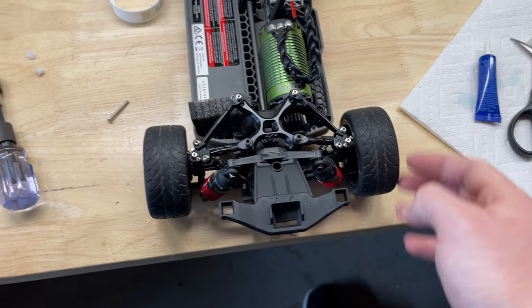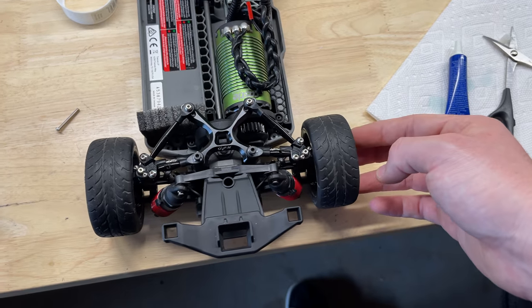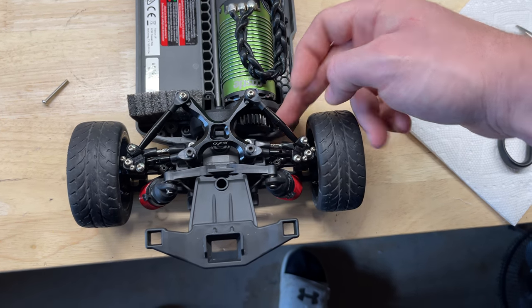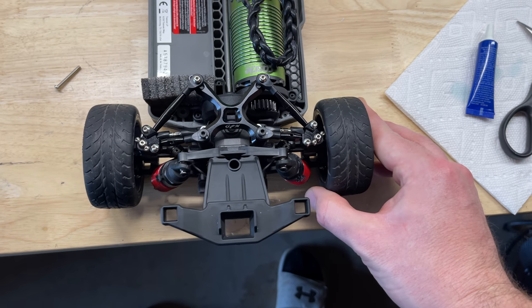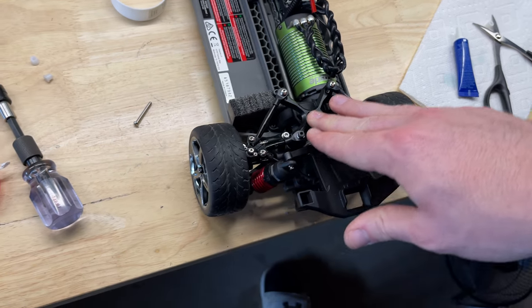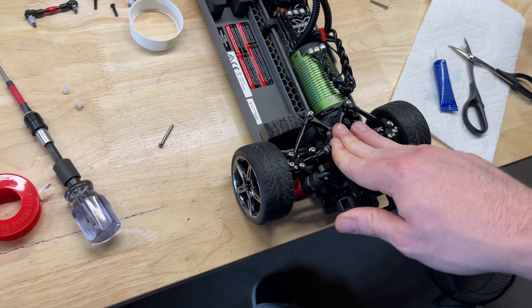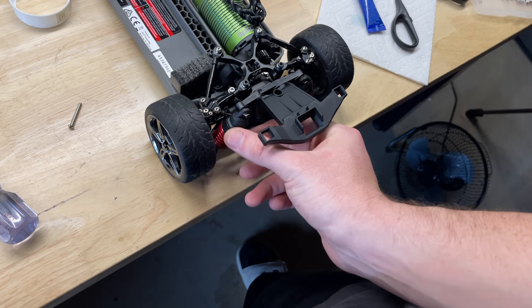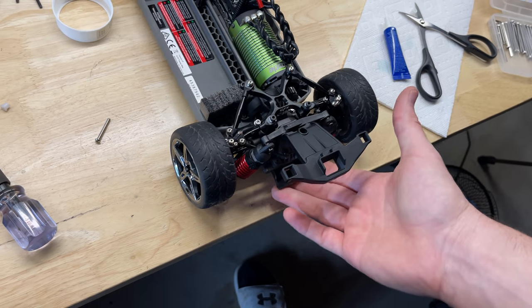Looking at the toe in on the rear, looks good. If I need to change it, I can, of course, adjust this one down here and that will pull that wheel in just a little bit. But the rear is super, super nice and stiff, but it's still got some shock action. If I wanted to, I can take maybe two of these out and raise the rear up a little bit,